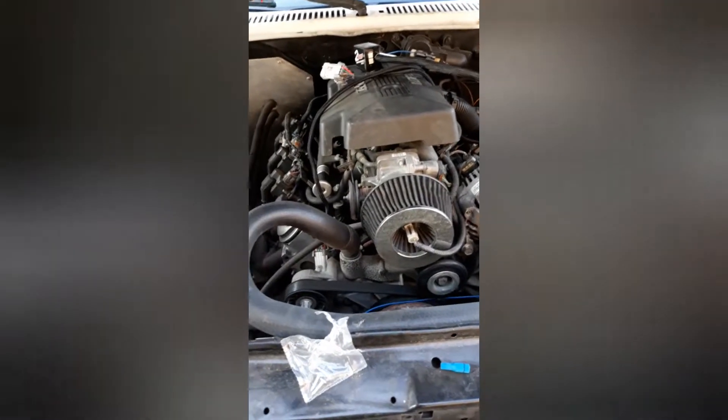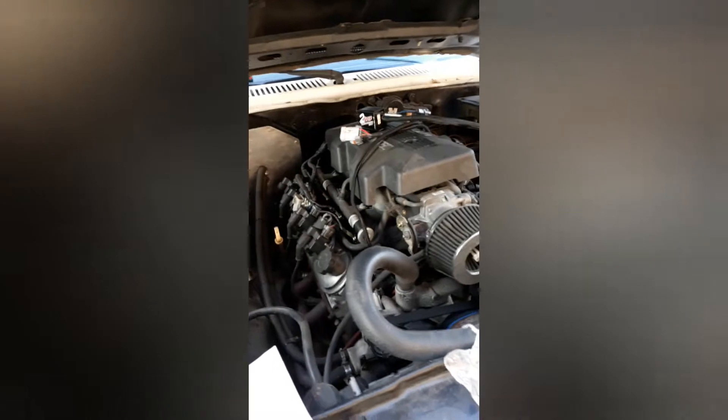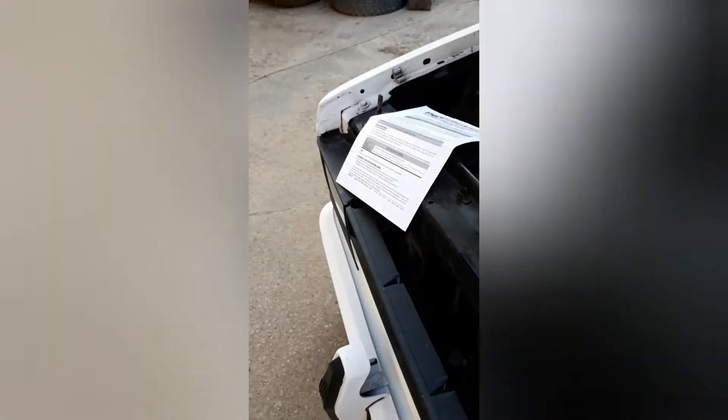So it's two-stepping when I'm clutched and shifting at wide-open throttle. My concern was: when I hit the clutch, is it gonna drop the engine RPM down to the rev limiter? It says clearly in the manual that the RPM must drop more than one-third of the set launch limit. For example, if the launch limit is set at 3,000 RPM, the engine speed must drop below 2,000 for the launch limit to become active.